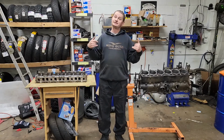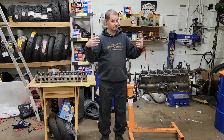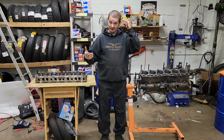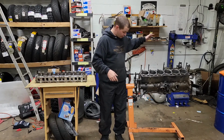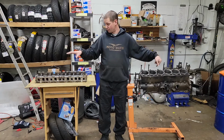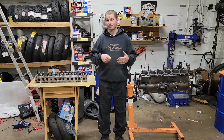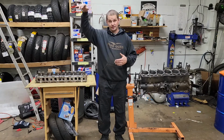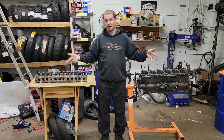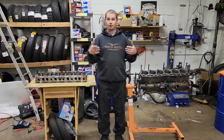And then from what I've seen, once it's dry, you can just go and paint it. And I'm hoping that's the case. So I'm going to brush these completely down with mineral spirits one more time, both of these. Put them underneath the heater after I've blown them down with compressed air. I'll put them underneath the radiant heater, let them dry really well before I can come in here and tape them and spray them. So that is the plan.